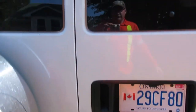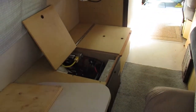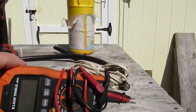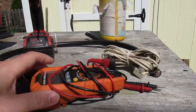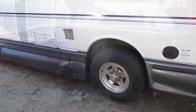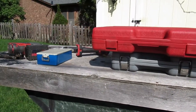So the first thing you do before you get dirty is make space so you can access the electrical equipment in here, before you start crawling around on the ground. You're going to want to get a multimeter. Turn it on, put it to AC, test it in a receptacle somewhere and make sure it's working. The camper is not plugged in but it does have an inverter, so it's important to be careful so you don't shock yourself. I'm going to get this stuff set up, then we're going to go in the van.